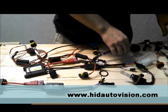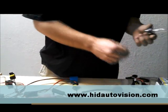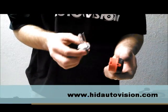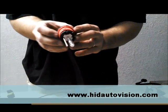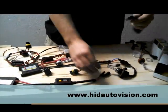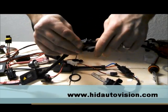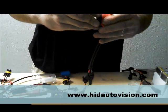I want to show you one more thing on the D2 bulbs — these are the factory HID bulbs. On these D2 bulbs, if you're just getting the bulbs from us, you're already going to have a connection similar to this in your headlight assembly. Basically what you're doing is pushing that, twisting it, and that locks in — your bulb goes in like it always did into your harness. If you have an aftermarket ballast like this, this wire has bullet connectors on it so you can pop them right in. Then run this into your headlight assembly where your stock one was.